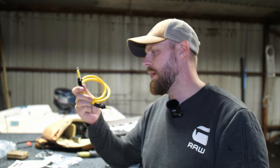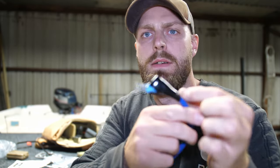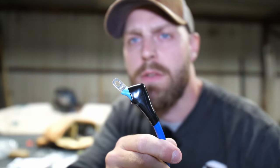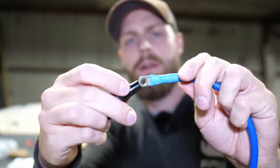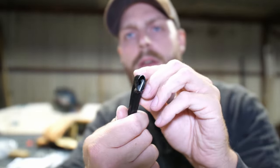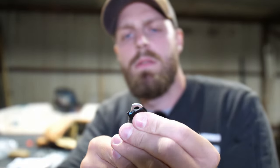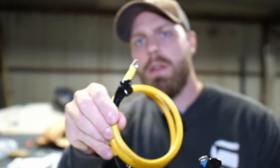When you're running the cables from the winch down to the relay, don't forget to put on the small rubber protectors — they have to be on. Put it on like that, and then you just press. It seems to be stuck for the first part, but then when you get it in you just twist and push and it's done. Make sure you do that on all the cables.